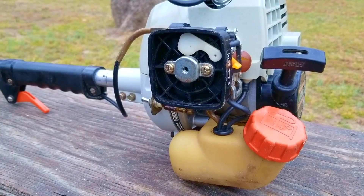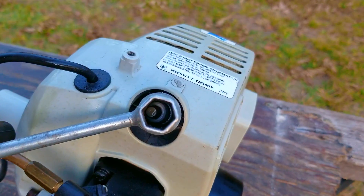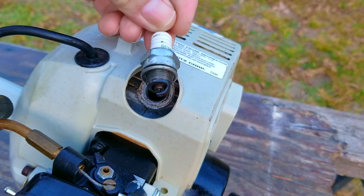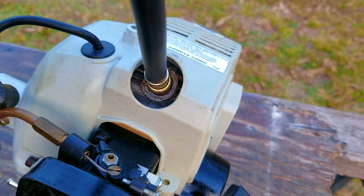That has to be the most abrupt test I think I've ever seen. Most of the time I have to pull the rope a few times and then it'll run for a few seconds, but this one was one pull and then it ran for exactly one second. Even though it started — confirming that we do have spark and enough compression — I still want to do a compression test to see how worn out the engine is. This might explain why it ran the way it did.